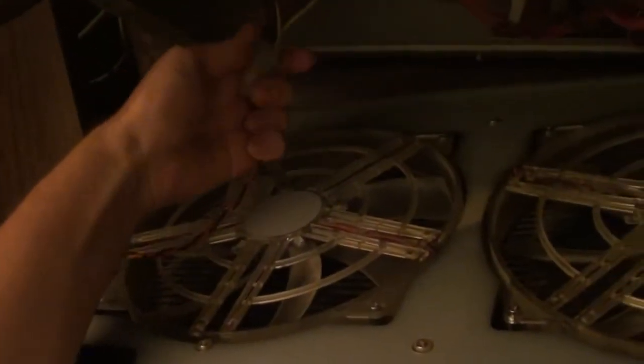I'll go to my PC and move it around. Whenever I open a PC and make modifications inside, I always unplug the power first. I only have one screw holding this side of the case on - I'm going to unscrew this, set the screw, and take this panel off. I have this large fan here - I'm going to disconnect that. These large fans on the side of my case help prevent overheating of the computer and the hard drives. I have four hard drives in here and I do not want data loss due to them getting too hot.